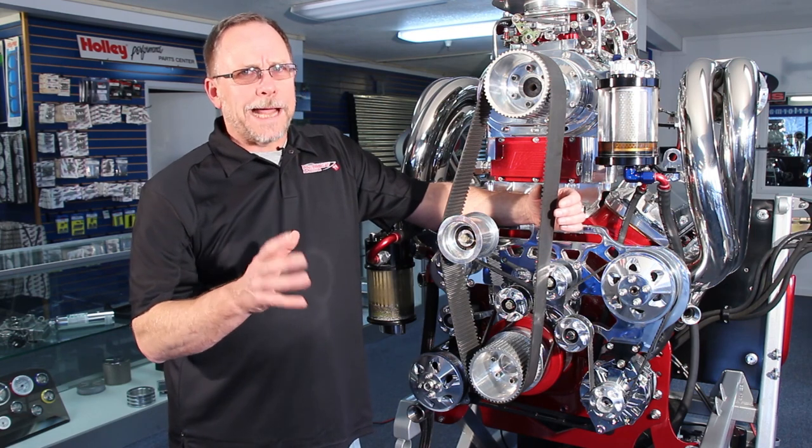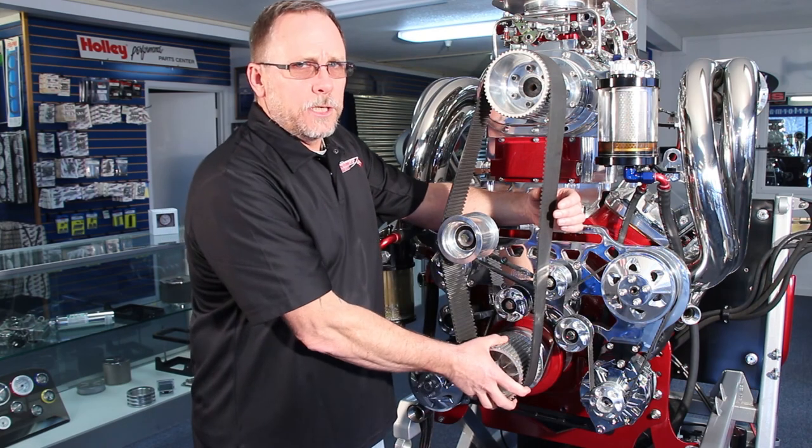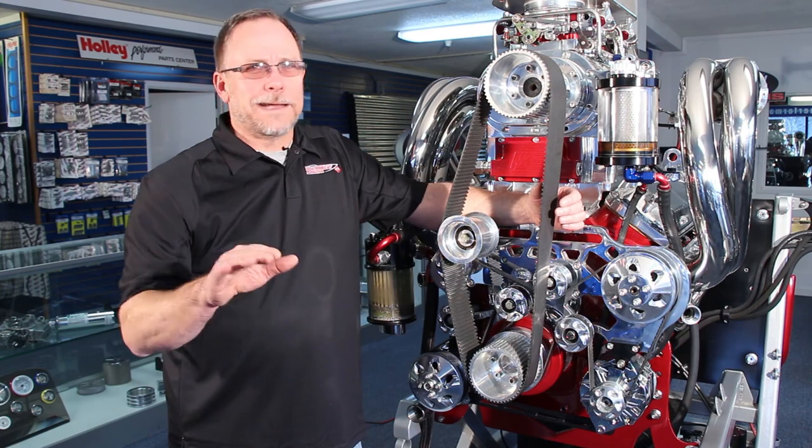You want to make sure that you do not run this belt too tight. If you do, you can damage the blower bearings or crankshaft. And if it's too loose, the belt comes off — and that wrecks a great day on the water.